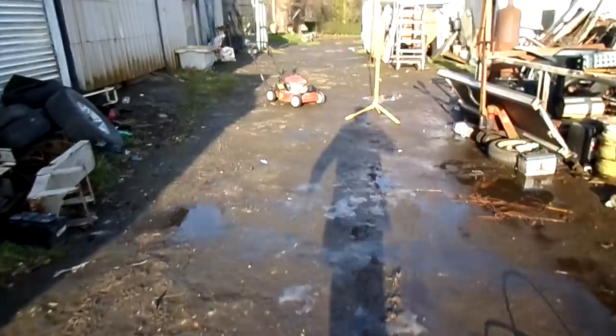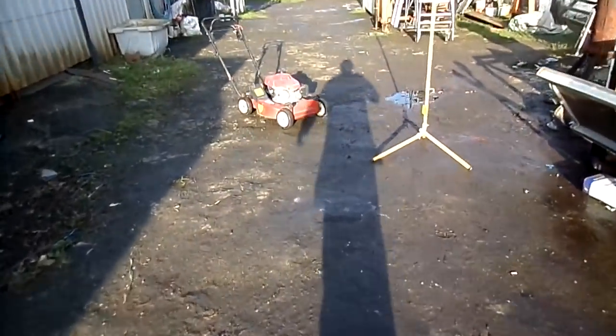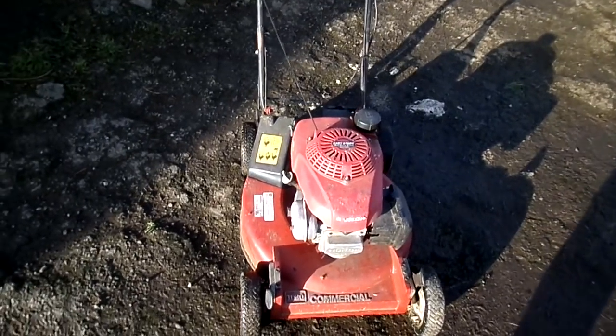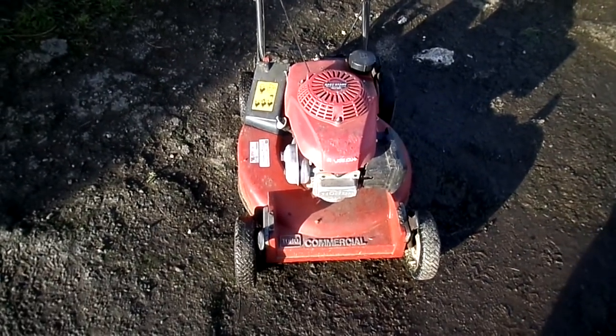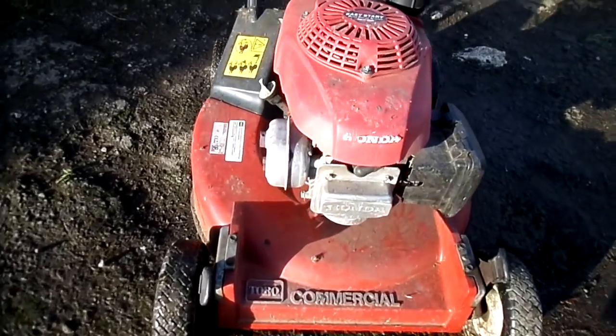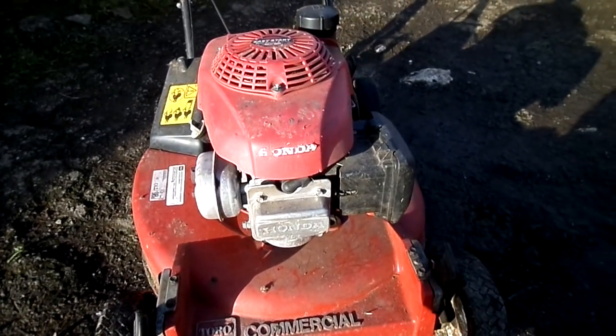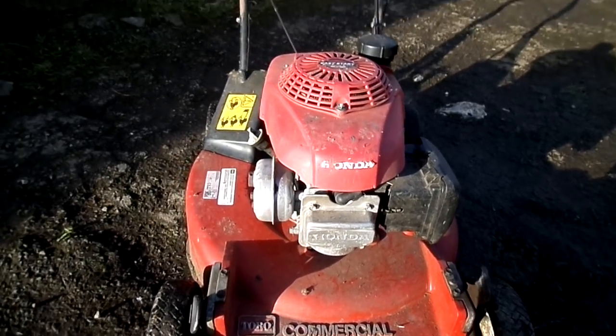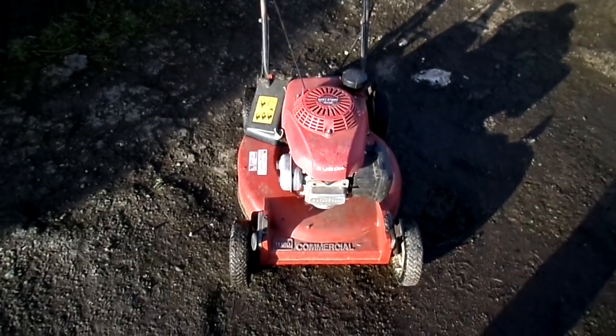I hope this video helps. Like I said, I really see people struggling with turning lawnmowers over and turning them over the wrong way — and you can see they are going to have trouble there. Definitely tip it over to the exhaust side, definitely not to the carburetor side, with the carburetor underneath to the ground. Thanks for watching — please like and subscribe, cheers.